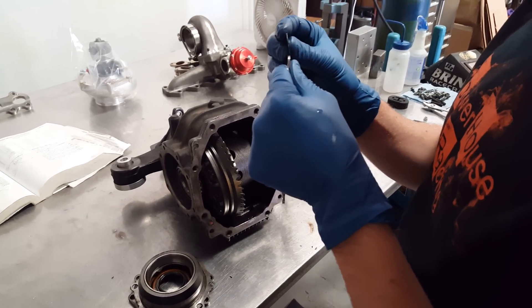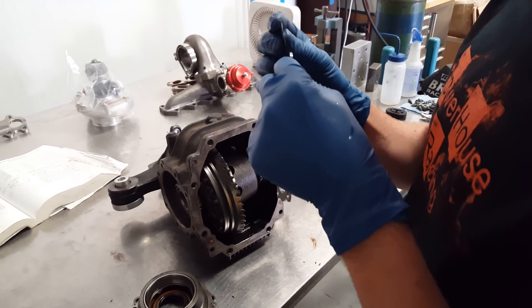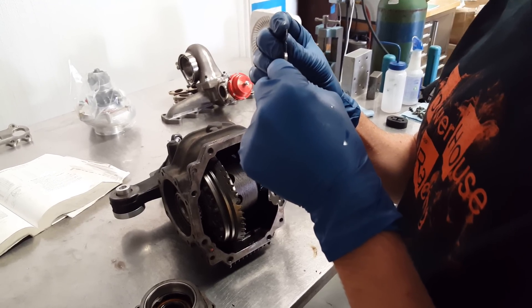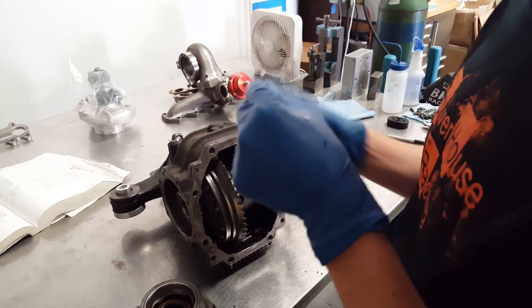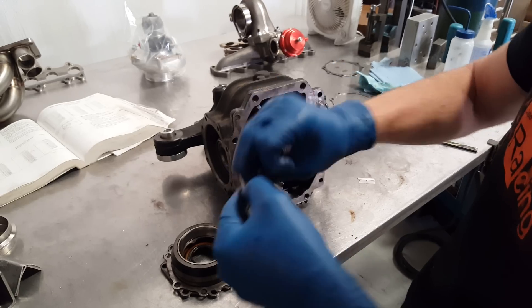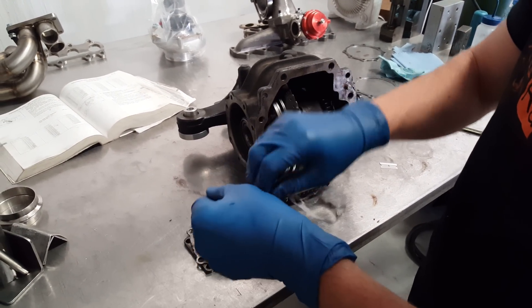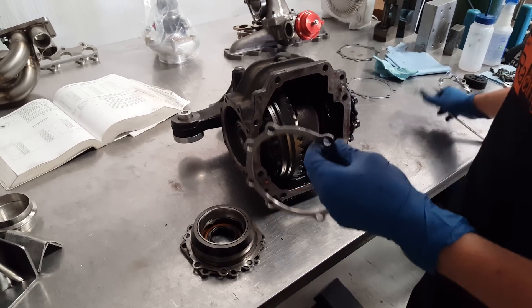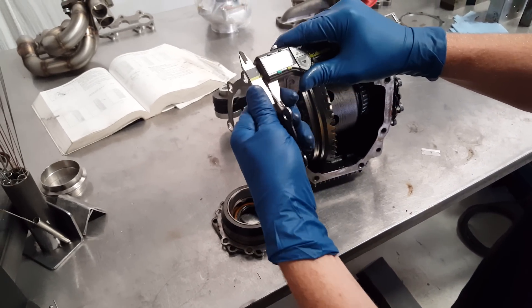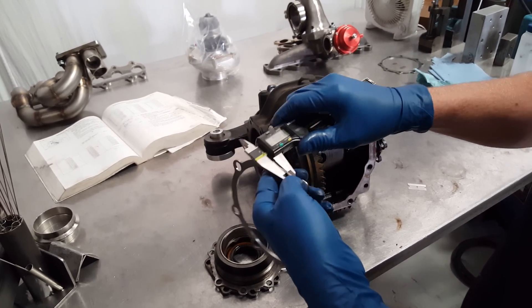You have to get a little bit wider than you need and peel away and measure as you go. I'll show you — you get right in there and you can see that layer starts to peel away right there, and then I can just peel that layer up and away it goes. Now we have a new thickness on this where we're at about 0.081". There's a little bit of glue on here so it's not exactly perfect, but as you can see we're thinning it up slightly as we go.